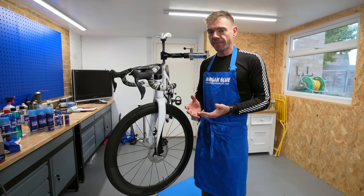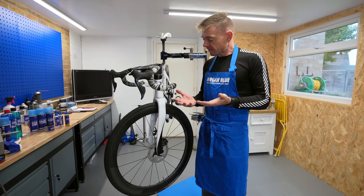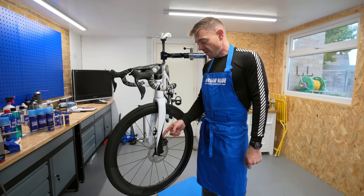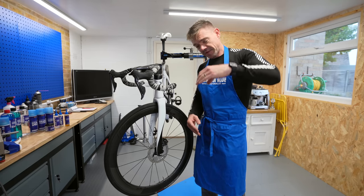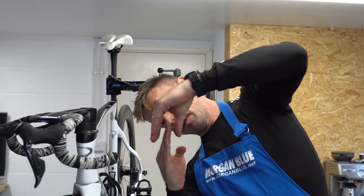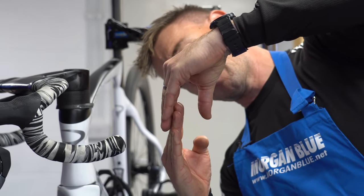The reasons why you might be getting that really annoying noise - a hissing or ding ding ding as you're going down the road - is because either the caliper is not aligned to the rotor. If these are your brake pads and this is your rotor, you want equal daylight left and right. The first problem is normally the caliper being misaligned, so the rotor is sitting off-center in relation to the pads.